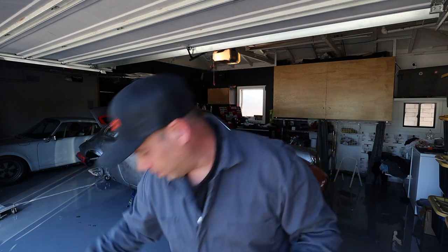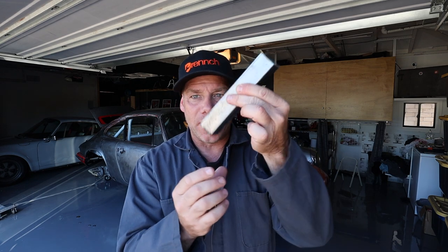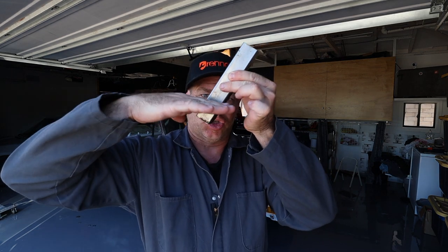So then I'm gonna take a piece of, I think I have like a really small, like a half inch piece of square tubing, and I'm gonna level it so it's perfectly level, and I'm gonna tack it in. So what that's gonna do is it's going to locate a cross member that's gonna hold these two pieces of bar together. And the reason I wanna do that is that's gonna keep them in the orientation they need to be in. And then I need to figure out how I can cut them. Like, imagine this. Imagine that this thing's at some weird angle, but I need to cut straight across it.